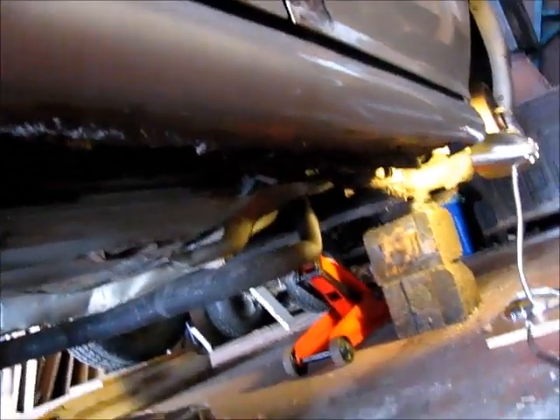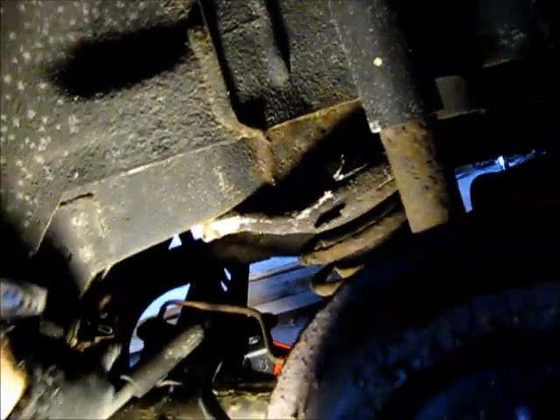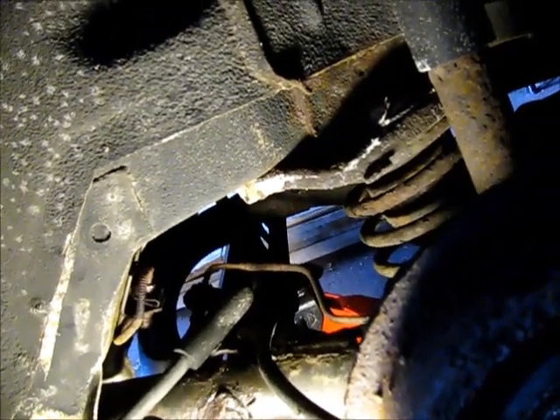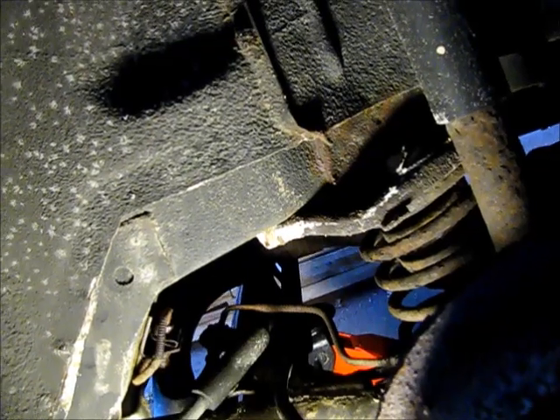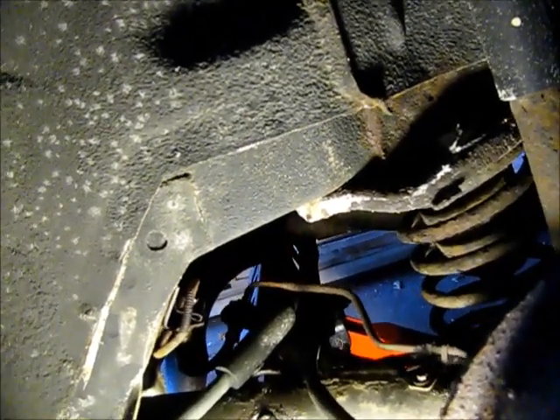About a three-foot section from here ending right down near the wheel, then a straight section that runs about 50 inches — about four feet — and then another basically three-foot section going right back to the wheel. So job one: I want to disconnect this line and get this fitting out. To do that, I'm going to need to probably heat it up and turn it out of the brake hose, because I'd like to reuse that brake hose and not have to redo that as well.